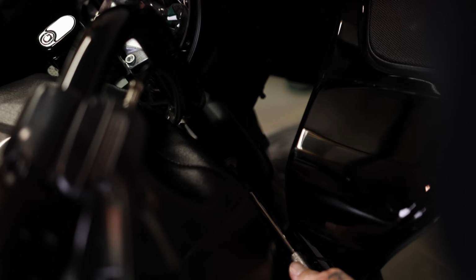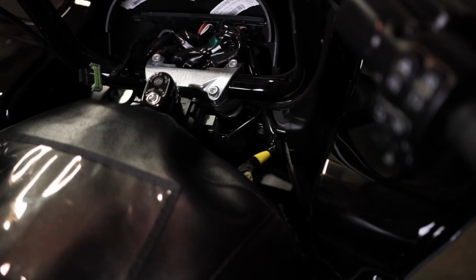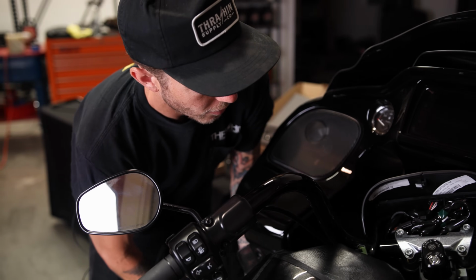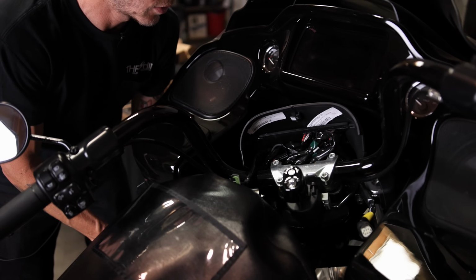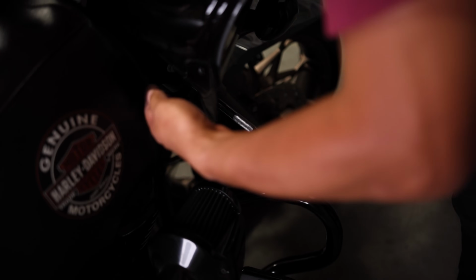All right, so you're gonna continue taking the nacelle off. Grab an extension so you're not near your fairing. Just use the T40 to get the side nacelle bolts out. Make sure that when you are removing the side nacelle, you do take all 4 bolts out, the ones that are a little bit lower on the trees.